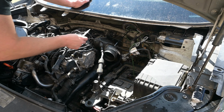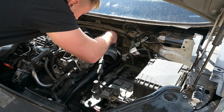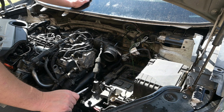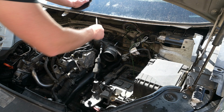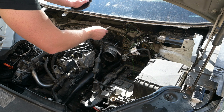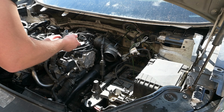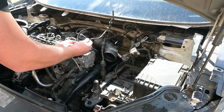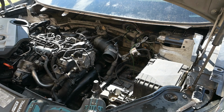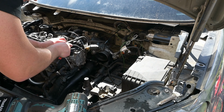Now when I'm looking, I've seen that actually I took the brake servo from the old Seat Leon FR and that was laid on top of the engine. Now the actual brake servo that connects to the brake lines and to everything else was sat on the back bracket. So what I've done is stripped off the pipes and the hoses off the new Seat Leon brake servo and reconnected them back into the Caddy servo. Now it's a little bit confusing, but all I basically done was brought one with me from the Leon and I didn't need to do that, but I've done that on purpose because I didn't know where the pipes went. So that was me being quite sensible, wanting to understand where the pipes actually go.